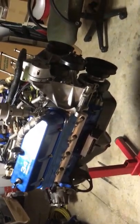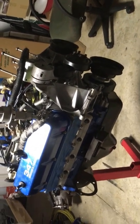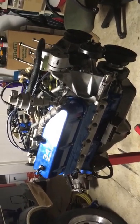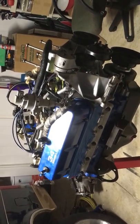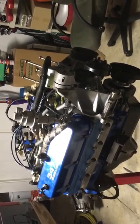Long story short, another question I've always been asked is why not go 351 — wouldn't it be cheaper than a 347? Yes and no. The truck intake manifold for the 351 and the 302 are different, and the 302 truck intake manifold actually flows better than the 351 intake manifold. So if we had gone to the 351, we would have had to spend probably another $700 to $900 for an Edelbrock high-rise EFI intake, and I really didn't want to do that.